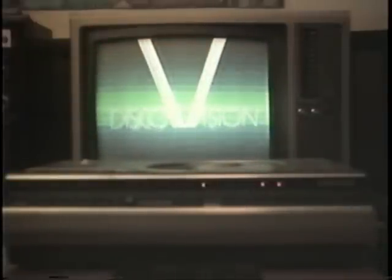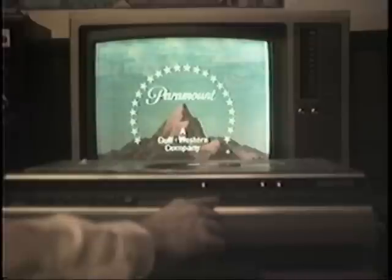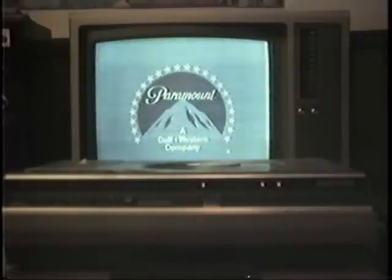We first turn the power button on, which is right over here on the end, and the picture goes black. The disc is now warming up. Over here you have two lights that have come on for your audio channels — left and right channels. And now here's our picture starting. This is the old DiscoVision logo. This intro was actually dropped in about 1981 or so in favor of the new generic Laser Vision logo. And now our movie starts. This light over here is for play — it came on automatically as the disc got up to speed from zero and began to play.